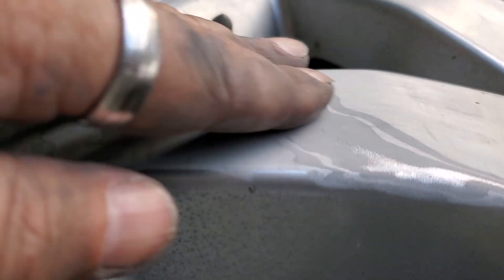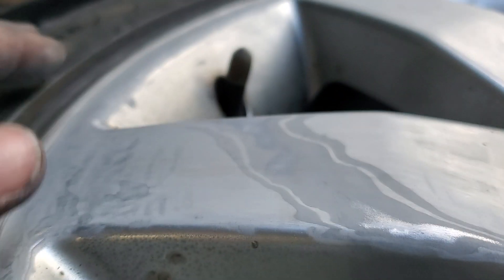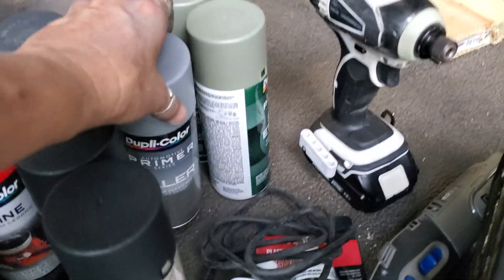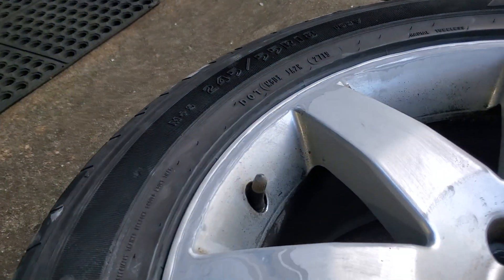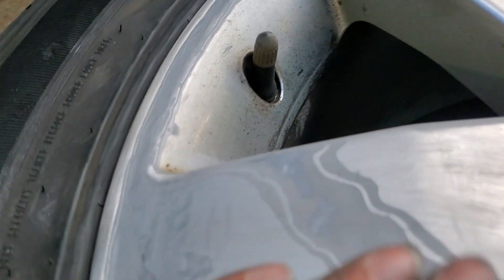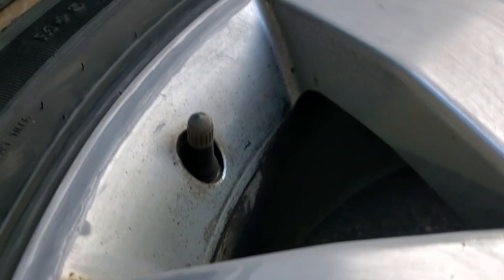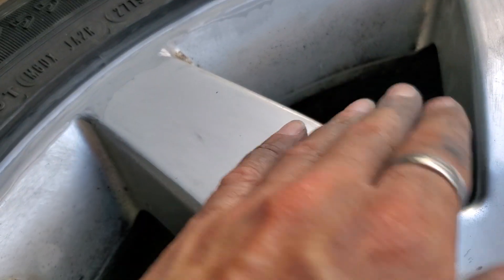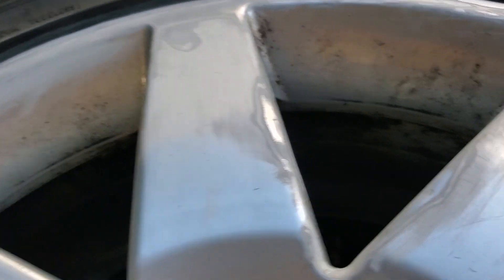I will have to do a little bit of recontouring with the filler primer because this has become a low spot now. I didn't have any fast build, but I did get the filler primer, so we'll see how well it does to build this back up and get it at least flat. I went through all the way up with all those scotch brite discs and then sanded a little bit with 320.